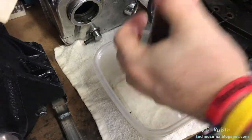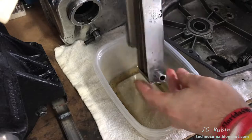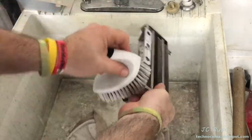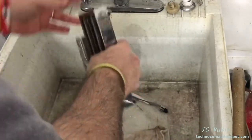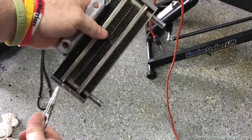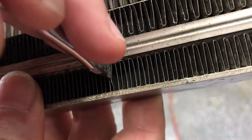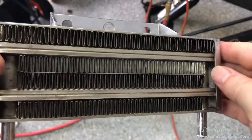The oil cooler system has been soaking and agitating for some time. We give it one more shake, drain it into a bucket to see what we got, then put it over the oil drain pan to let the rest drip out. All the kerosene drained, we spray it with a strong degreaser, clean it out with a brush, and wash it out. Once everything's been cleaned out we blow it out with compressed air to remove all the water. All the fins are then repaired - any bending in the fins is superficial, just at the fronts, and we fix it with a screwdriver. All fins are now repaired on both sides and we can see straight through.